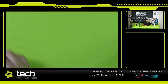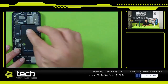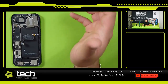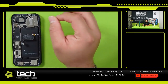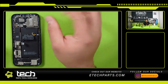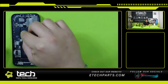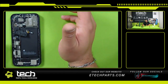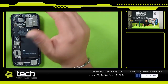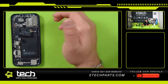That's pretty much it for today's stream. We just wanted to mention that common issue people have been calling in about, which is related to the sensor flex. In the event you do damage the original sensor flex, in some cases it's fixable — it's a micro-solder repair where the sensors have to be either transplanted, or there's a Face ID resolution flex cable. Some scenarios of damage are repairable, but the majority aren't. What you can do is replace the sensor flex cable, which will allow your phone to boot normally and won't cause a display issue. But because this cable is tied to Face ID, Face ID will no longer work — so that's an important thing to keep note of.